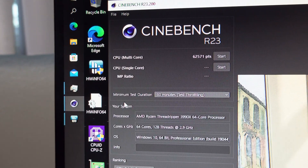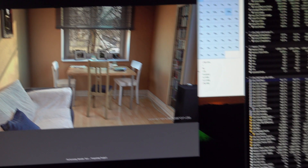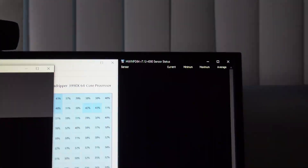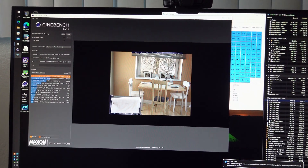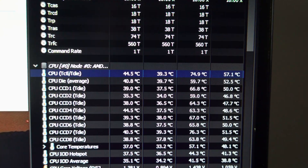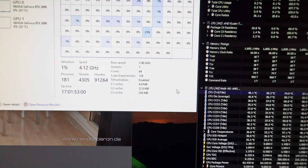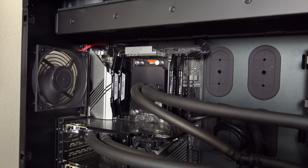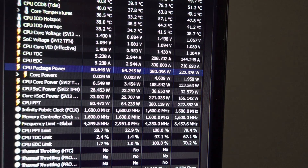Let's run a 10-minute full soak and see what it does. I have the Cinebench R23 test duration set to 10 minutes and start. We're going to reset HWInfo64 and we'll come back after this — who wants to sponsor me? The CPU T-die maxed out at 74.9 degrees Celsius. That's 64 cores — an amazing temperature for that many cores in that little tiny space. The CPU package power was 280 watts. Absolutely bonkers. Basically, 280 watts to run 64 cores is really, really impressive.